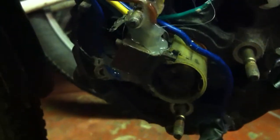And yeah, I've just soldered, and then I think I've hot glued this, just part of gluing this thing on. The armature windings just out to live and neutral, and bolted the three wires on. Didn't have to do anything with the common, that was just as it is. And put the cover back on, and off we went. We now have a motor. So there we go. So we'll rewire, and no harm done. We'll try again.